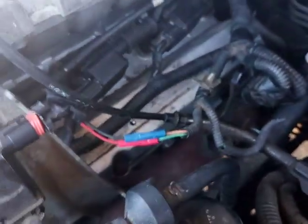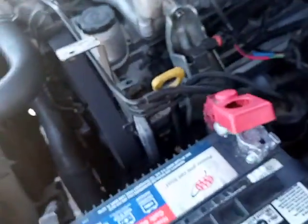That is static. That's what I mean. Shock. And that's where the shock came from. So the wires will have to be replaced, going to that side of the bank of the engine. This side of the bank is firing, but there's a problem with the connectors.